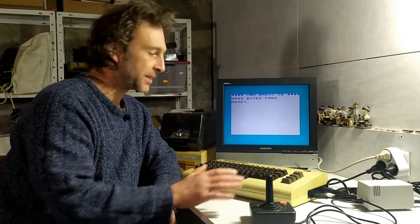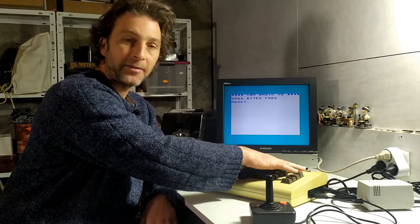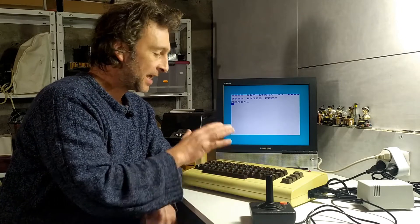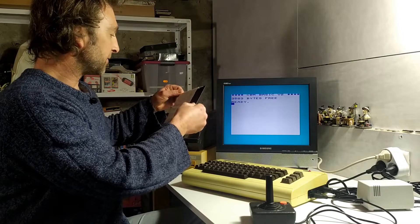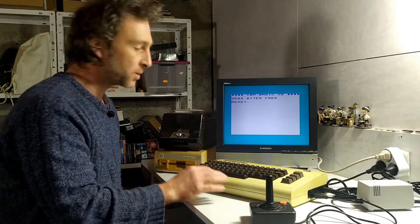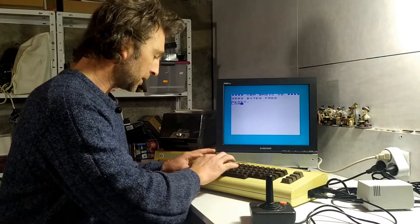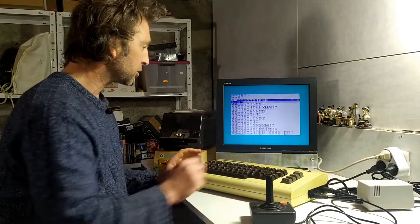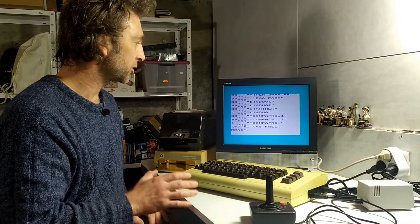Here we are back in front of the VIC-20 and we're going to try a couple of little cartridge experiments. I've plugged the expansion card into the back of the VIC but I've only enabled the first two switches, which means the 8 kilobytes of static RAM on that card are available to the VIC and can also be written to — effectively we have a VIC with an empty cartridge plugged into it. On this 5.25-inch disc I have a couple of 8 and 16 kilobyte cartridge files, and we'll try loading one of the 8 kilobyte ones onto the static RAM to see if we can run it.